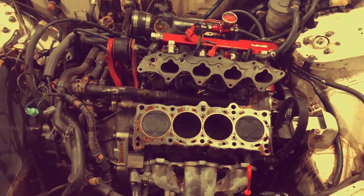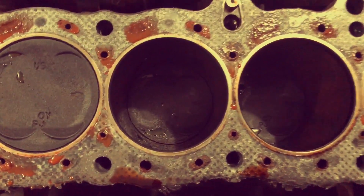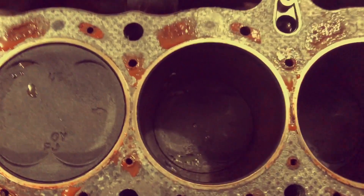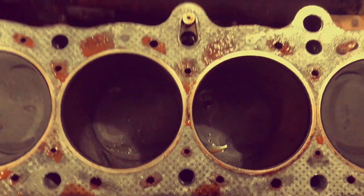The head's off. This is what it looks like without the cylinder head on. Just a couple notes — I don't know if this was from once I removed the head that it got leaked in there prior, or if it's just been settling in there, but yeah, coolant should not be in there.